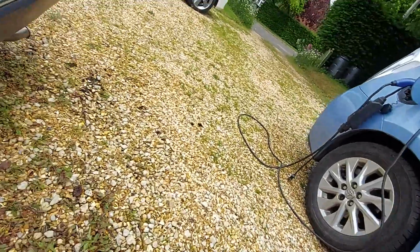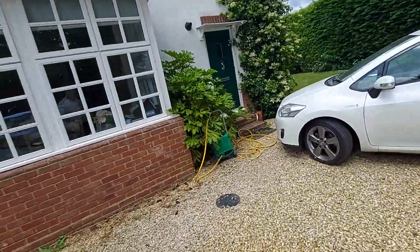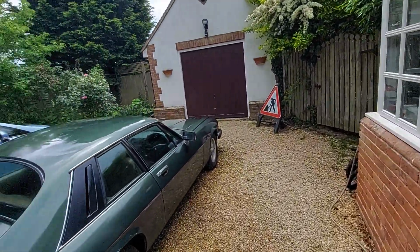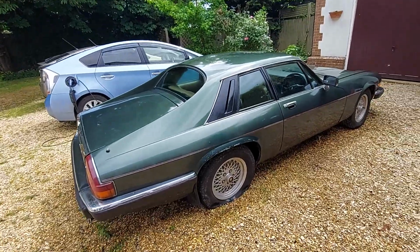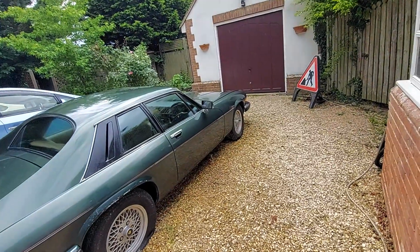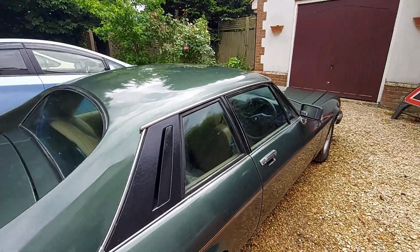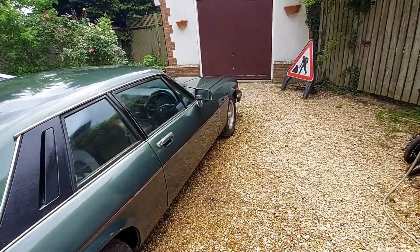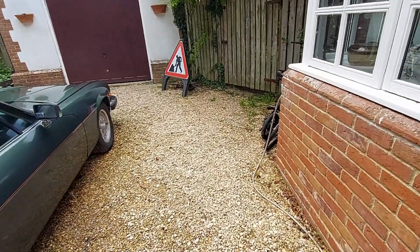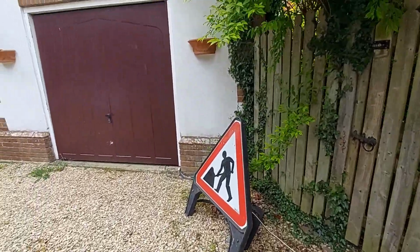Anyway, it's going to need welding, and you're going to do it properly. Basically, you need to take the whole thing to bits and then put it all back together again. That's what I'd do. And I believe the wings are bolt offable and replaceable. The front ones are anyway. That looks like it's had filler in before, and it's down there, and that needs replacing. But it spins over and it goes into gear, but again, that needs attention.